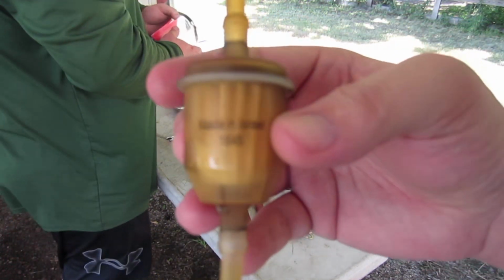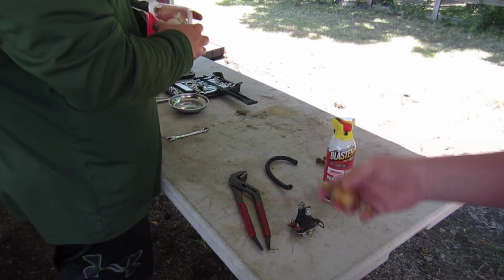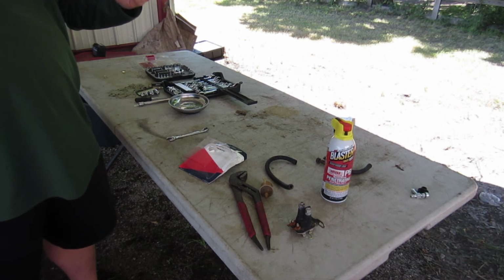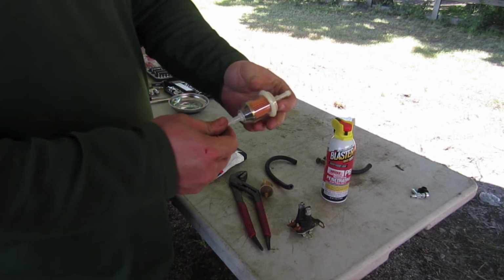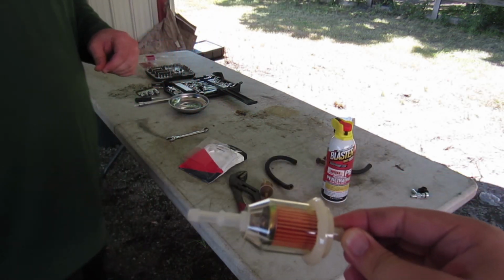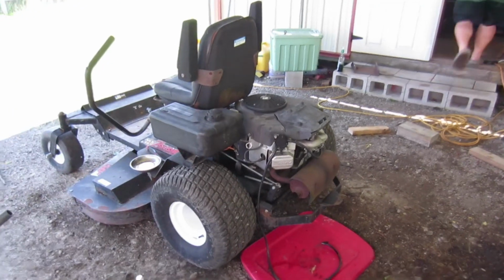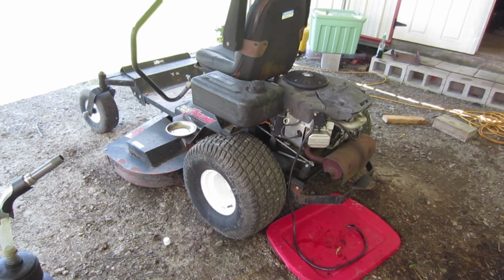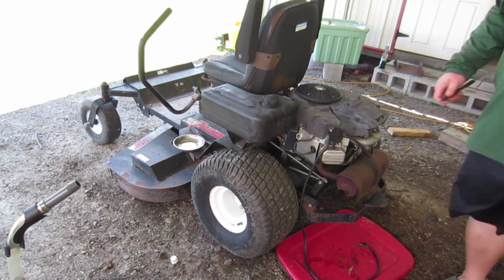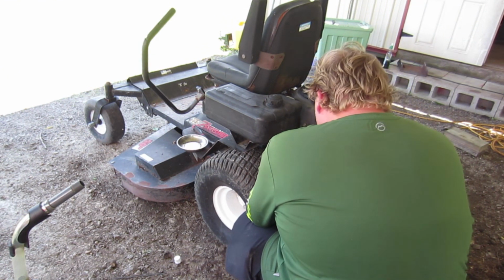Oh, you got these. Made in Israel. That's pretty neat. I didn't know the Israelis were making stuff like that and exporting it. Are we filming? Yes, we are. If you notice on the filter, there's a tiny little arrow there. That's which way the fuel has to go. We're going to stick that on with a couple new lengths of hose, which we already have laying down over here. We were using it as a temporary measure for the VP Racing fuel tank, not sponsored. Although we wouldn't mind. So, call me.